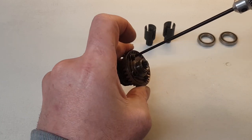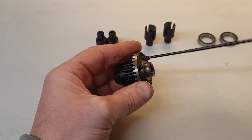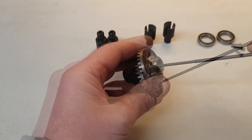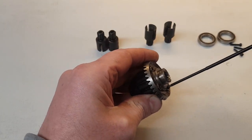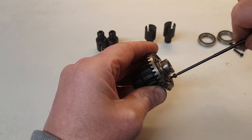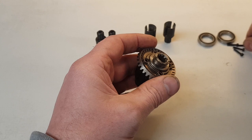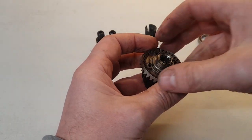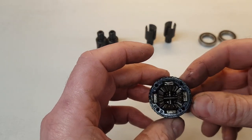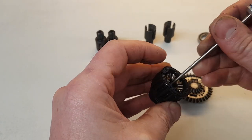What we'll do now is slacken off and undo these four bolts, which will let us into the actual diff casing. When you're taking a diff apart, you're either doing it to replace the ring gear or to tune your car by putting a different weight oil in. The standard is 30K — 30,000 weight. You can go heavier, which makes the diff stiffer with less tendency to spin up the inside wheel, or lighter for more spin. This is the first time I've opened this diff and I can hardly see any oil in it whatsoever — good job we opened it up.